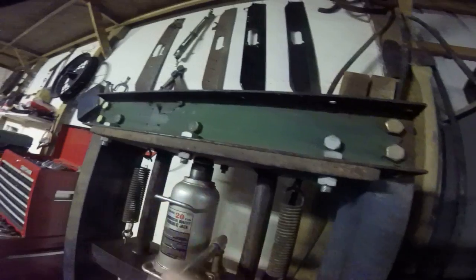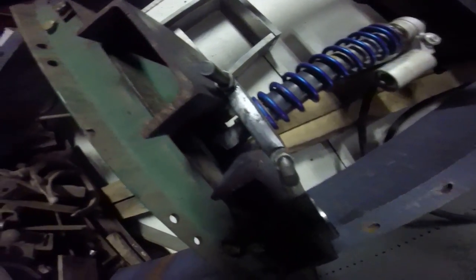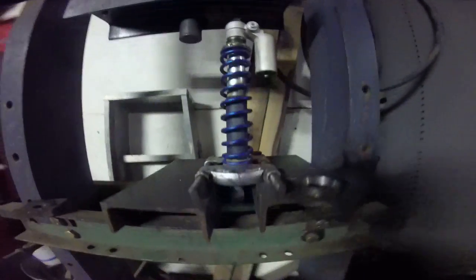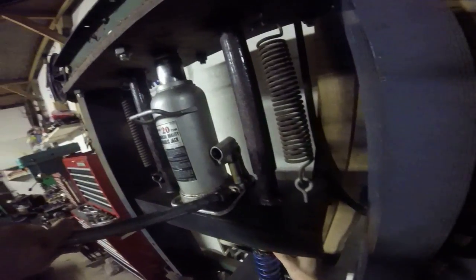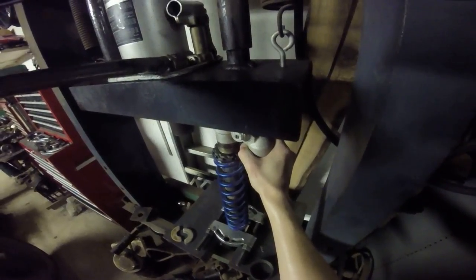Now you want to be careful when doing this so the spring doesn't come off, because it's extremely dangerous and it can hurt and probably even kill you somehow, I'm sure. You can see down here, probably not because this press is so slow, but I've moved it about an inch so I can stick my fingers up here. Not where if it was to snap back it could cut them, but just enough where I can grab those 2 pieces out, and then I can slowly, I mean very slowly, release this and release the tension on it.